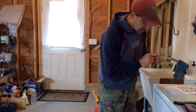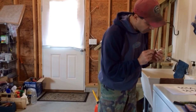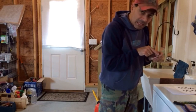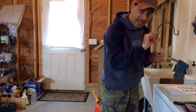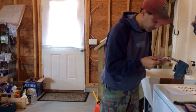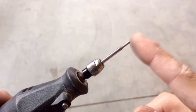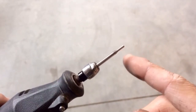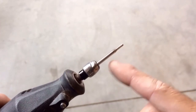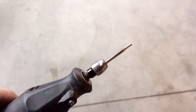It's actually coming along nicely — has a nice smooth edge, cleaning up really nice. Next I'm going to take the Dremel with a diamond tip bit and make little indentations where the S comes around on the tips. These diamond point tips for a Dremel or rotary tool are excellent for dealing with metal, masonry, or concrete — anything with a hard material. So that's what we're going to use to cut in the accents.